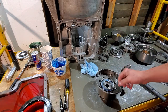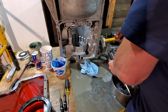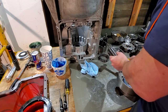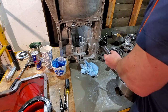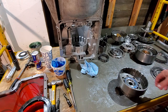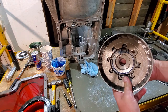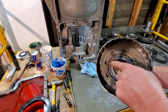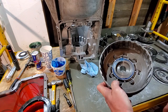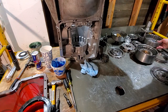The biggest thing is to make sure the opening of that ring stays in one of the windows. Easiest way: screwdriver, hammer, put the drum against you. Now that it's in, make sure everything is seated all the way around. If it's coming out anywhere, give it another few taps — it's not like driving in bushings, you're not hammering hard, it's more just the vibration that does it. The opening of the metal ring should be dead center of the wafer plate opening. The dish is down not up.